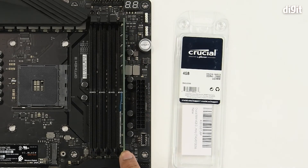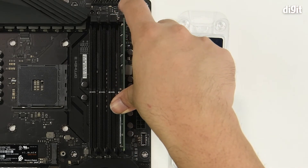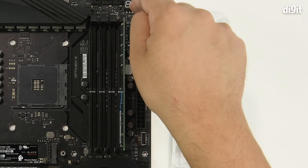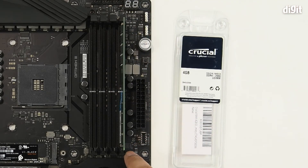In the case of slots where you only have a locking tab on the top, you would apply a little extra pressure to ensure that the bottom edge goes in first and then the top edge. You wouldn't want to lock the tab first and then try to push it in.